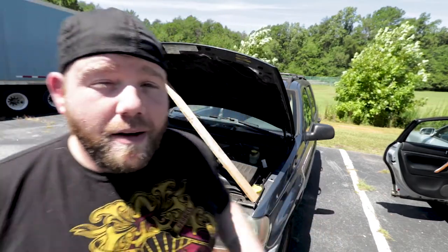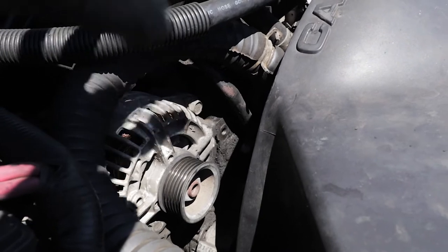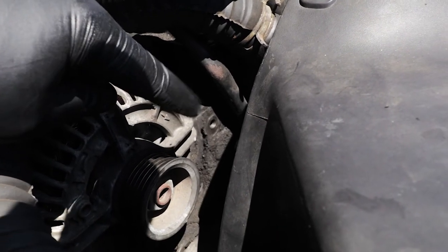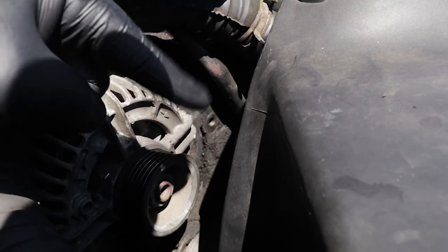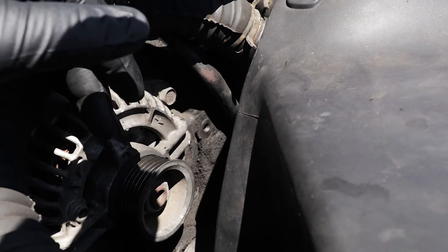It's sitting here and I've got all the parts to fix it. I got a new belt, a new idler, and the bracketry that holds it together because all of that got yanked off the car when it failed. So let's get started. Anyway, the belt tensioner lives right there — you see that empty hole in the cylinder head? That's where the belt tensioner lives. You notice there's nothing there now except the hole. Everything got yanked off and thrown away from there, so I'm gonna be mounting the belt tensioner there. And here in just a second I'll show you what the new assembly looks like and get started on it.